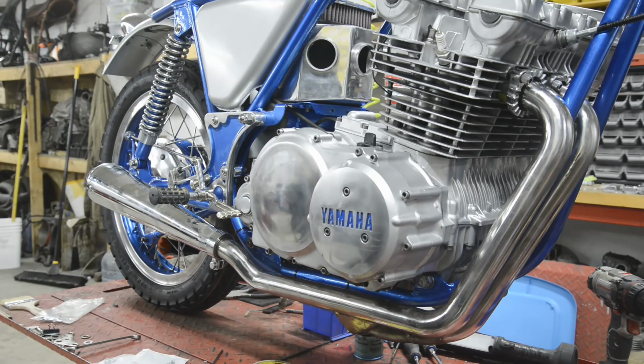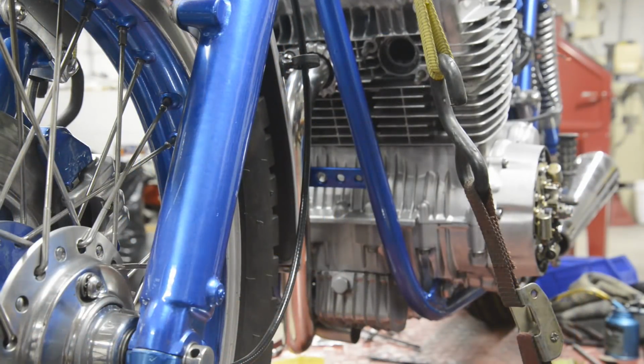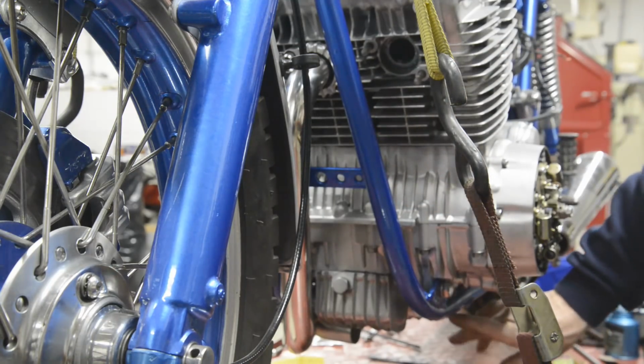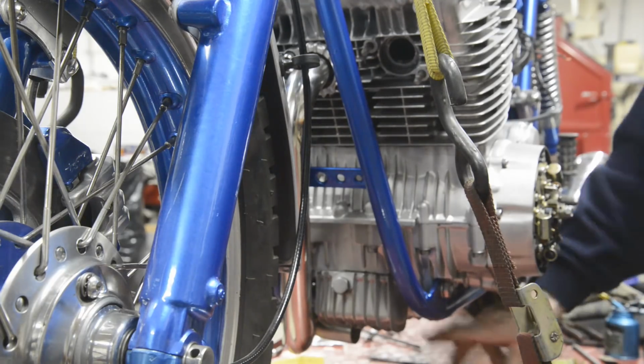Alright, now I've got to fight that last nut in on the exhaust port. So let me switch you off, and I'll bring it back when we go around to the other side. Right now with this pipe, what I'm going to do is put the pipe into the silencer, tighten it up, and then get underneath and measure how long I need this flexible pipe to be.